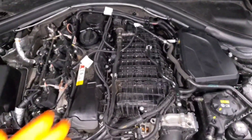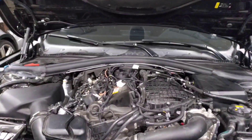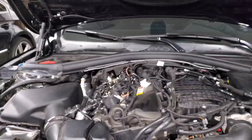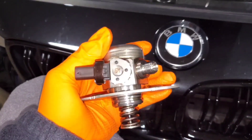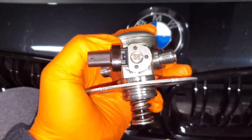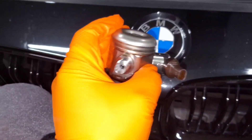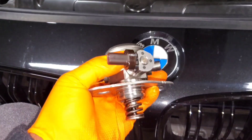Now that we have port injection available, it's highly recommended to stick with that route. So let's talk about high pressure fuel pumps. This is one of the most common upgrades now that we have multiple options on the market. I have the stock fuel pump here so you can see how it works. This is where the fuel comes in, this plunger moves up and down to create fuel pressure riding on the exhaust cam, and this outlet is where the fuel comes out.